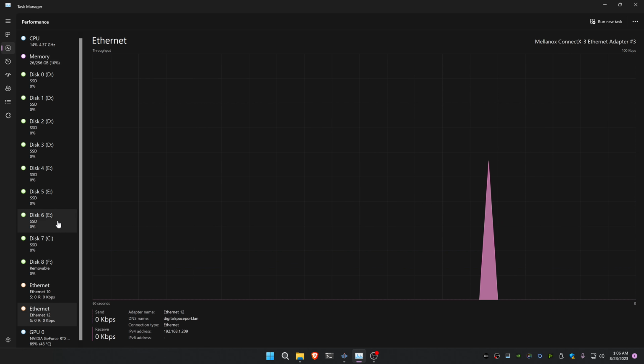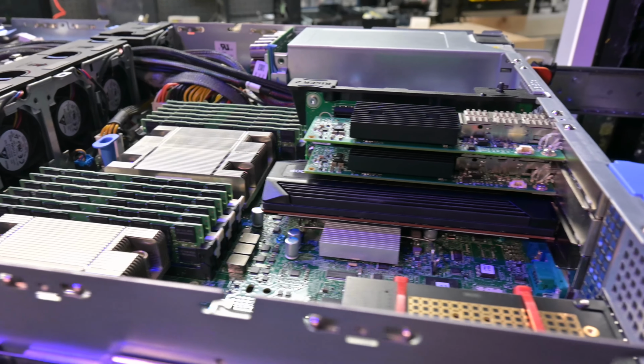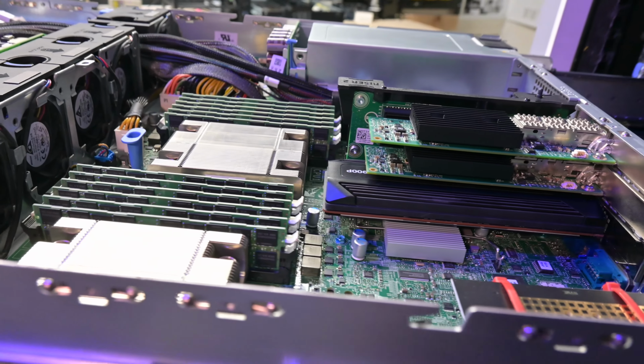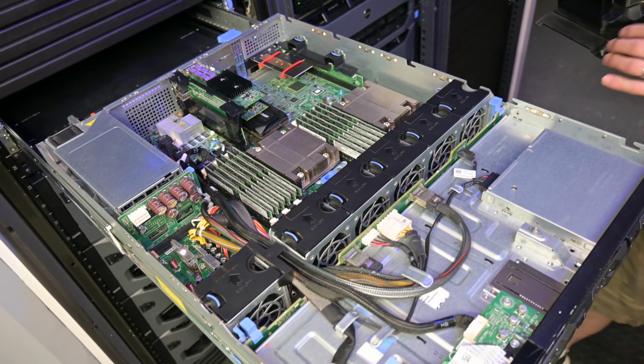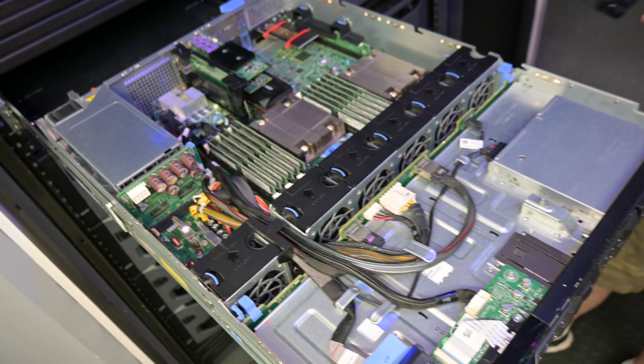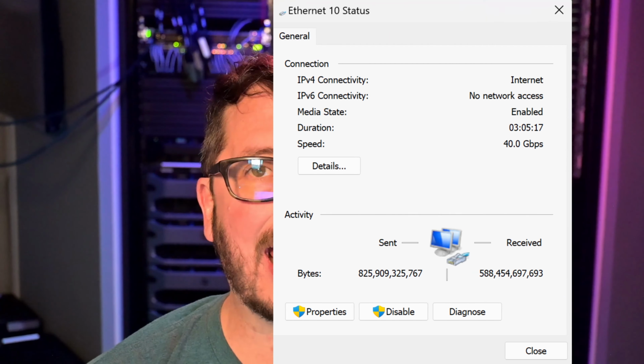And it's got three SX600 2.6 Fusion IO drives, which again, in a RAID 0 configuration, offers some pretty amazing storage. The amount of RAM in here, we have 192 gigabytes, and that is at 1600 speed. That is DDR3, and that is ECC, with two 2470 V2 Xeon processors. We also have some high speed networking. We're going to be having one 40 gigabit NIC. This is a Mellanox Connect X3 NIC, and this will definitely be able to push quite a bit of performance.